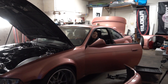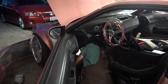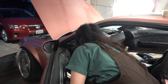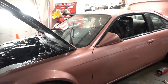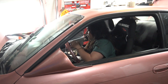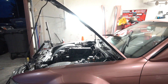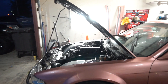Oh, the fuel pump! Yeah, the fuel pump. So Christine's going to go ahead and replace the fuse and then we're going to see if this thing starts up. Crossing our fingers, I'm pretty sure it's going to be it though. So can you hear the fuel pump come on first? There it goes!